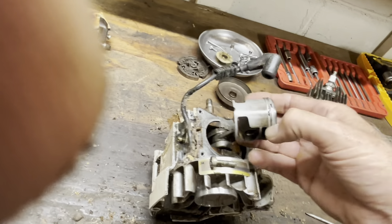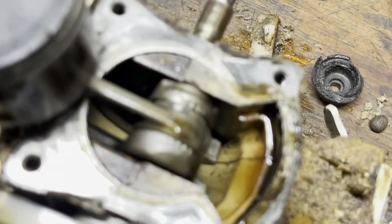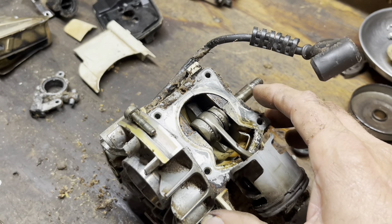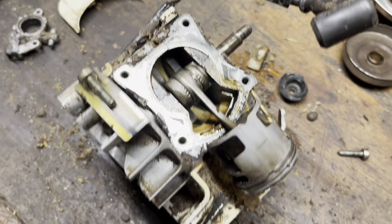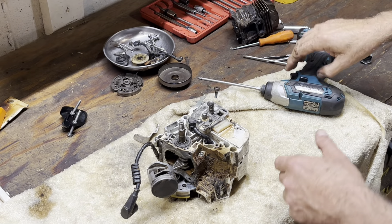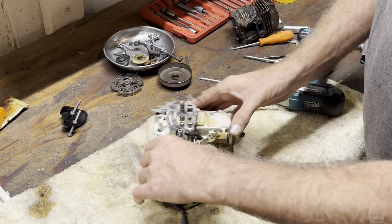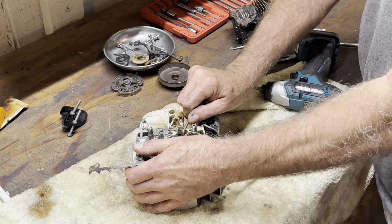This customer used to use Ultra for a long time. You look at the long-term coking. We could plug this thing into the computer and see what's up. There's nothing in there — none of the rollers. I took the chain catcher off — it covers up one of the bolts. Then you'll have to remove this rubber grommet right here, because it covers up another one of the case bolts. That's your sneaky one if you were ever so inclined to split one of these.